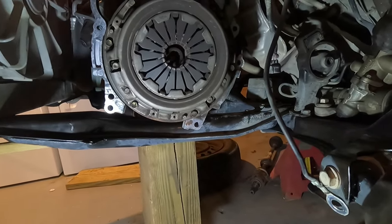Getting ready to go back in - I'm going to clean this off with some brake parts cleaner as it has a little bit of oil on it. The flywheel bolts torque at 36 foot-pounds plus 90 degrees. Got the flywheel back in place, torqued those to 36 foot-pounds plus 90 degrees - when I went back and checked them they all clicked at right around 70 foot-pounds.